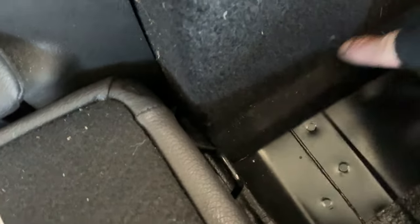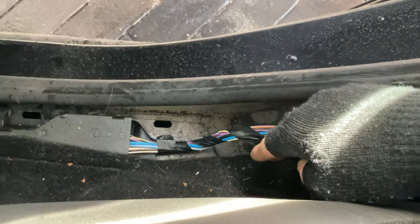When it comes out, it would come out down here, then out of this area here, and then work its way down into the footwells — that would explain why the footwells are wet. So that grommet is leaking on both sides, but the driver's side is a lot worse than the passenger side.